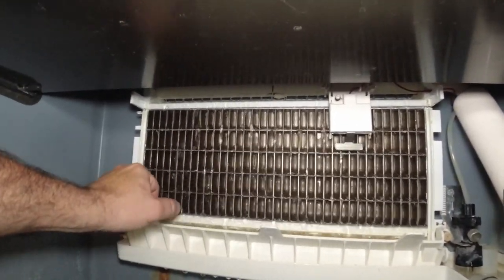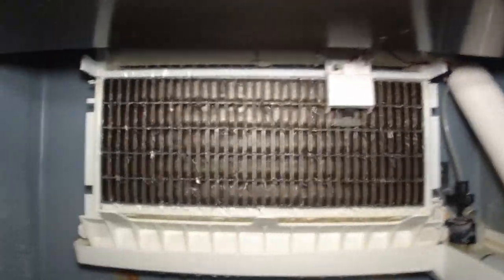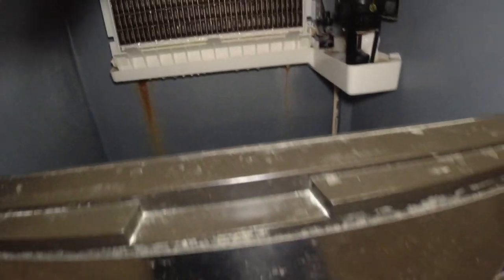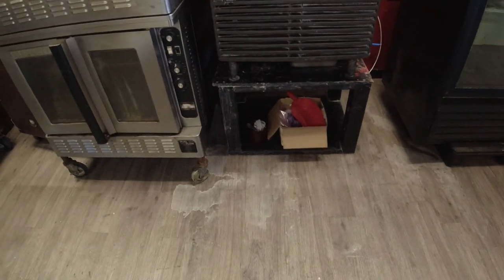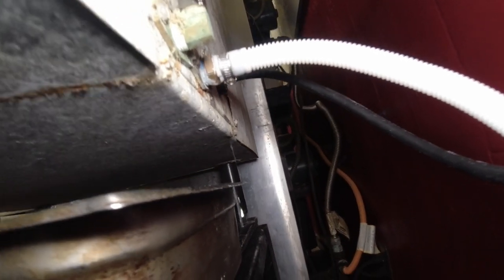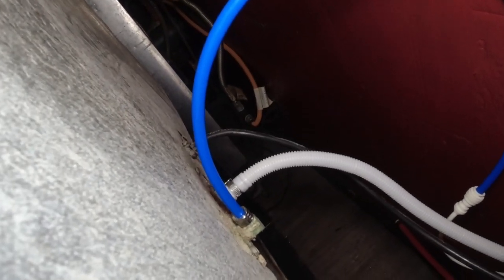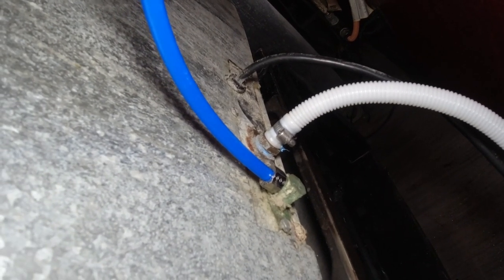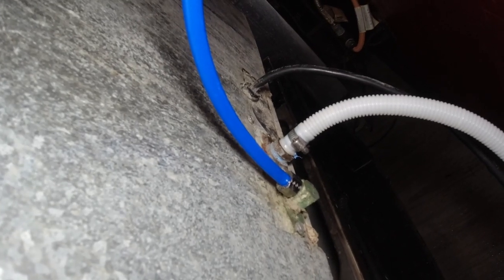It's a little slow - it's making ice but you can see how well it does on the harvest; that's where we'll find out if it's really low. It should have been frozen down by now. It's not real level either. They put it on a little stand to make it higher so now it's able to drain. Look at that - we got a leak, and that's probably the leak they're talking about. Looks like they over-tightened that and cracked it.